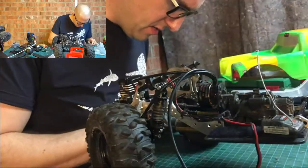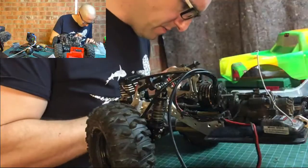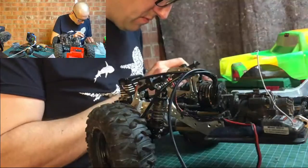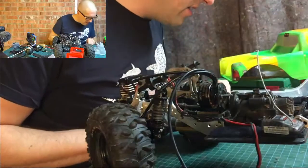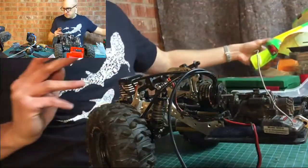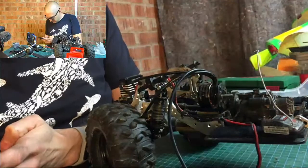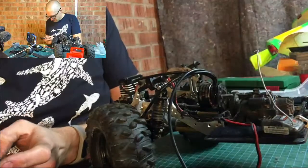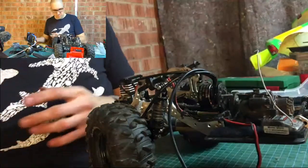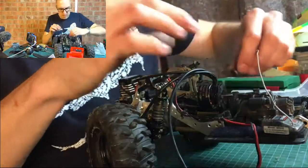Got a 13 in a 32 DP, got a 12 in a 32 DP, got a 17, that would be lively. If I change my gearing to a 13, that could be interesting. Let me just put that in the calculator. 54.69. Okay, still over 7 miles an hour, so we'll go with the 13. There we go. Learn something new every day.